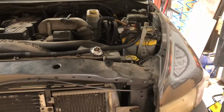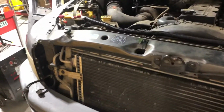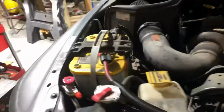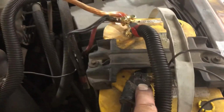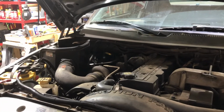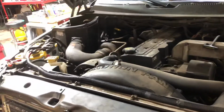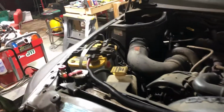Let's disconnect the batteries. This job that we just finished is a 2002 Dodge diesel. It's got the Cummins diesel and 2 batteries. No matter whether it's a diesel or gas, always remove your negatives first. Always remove the negatives first. Remove both negatives, then remove both positives. Why? You're going to be working around the airbags, especially the passenger side airbag. Once you remove these terminals, put them where they can't touch. You don't want them touching the battery. You just never can tell what those funny little evil elves that come out of nowhere could do. The idea is again safety.